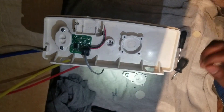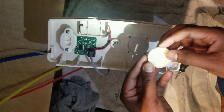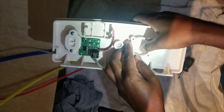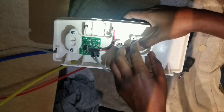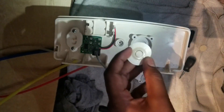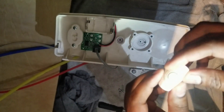We got the spacer out and the plunger out. Then there's another inner diaphragm — use your finger to push it out and inspect it as well. For this unit, the inner diaphragm was the culprit. As you can see, it is completely worn out.